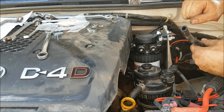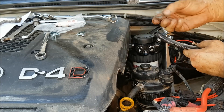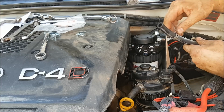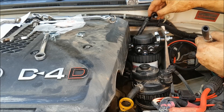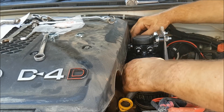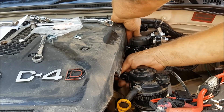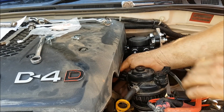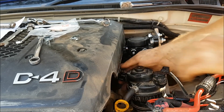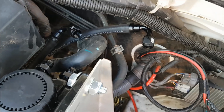I've pre-lubricated the barb end of the existing filter. I'm not going to use the provided hose clamps — I'm going to use the factory hose clamps because they're spring type, maintain constant pressure, worked on the factory system, and are much easier to get to after you've installed the hose. Feeding the second hose through — it's a bit of a nightmare. Now all the way on, and get that hose clamp around the front. Both barbed fittings are up the back.